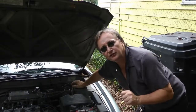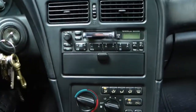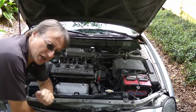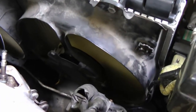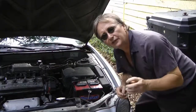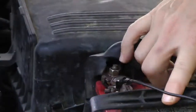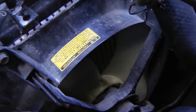Now if that doesn't fix it, the next thing to check is the cooling fans. Start the car up and turn the AC on to full blast, then check the cooling fans to see if they're working. In this case you can see the left fan and the right fan is turning. If the fans aren't working, there won't be enough air sucked through the radiator and it'll overheat. When they don't work, check the fan motors — they often burn out. To check if the motors burned out, just get a little jumper wire, stick one end on the positive cable of the battery, and stick the other end on the red cable that feeds the motor. If the fan doesn't start spinning, you'll know the motor is burned out.